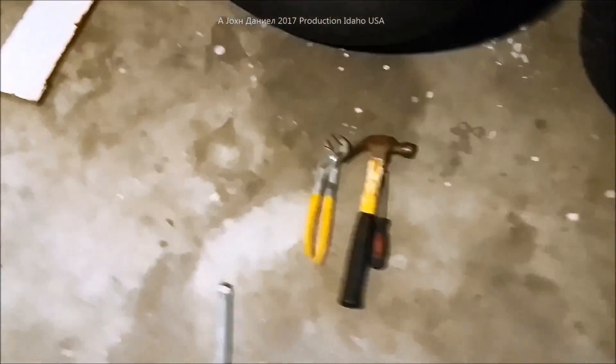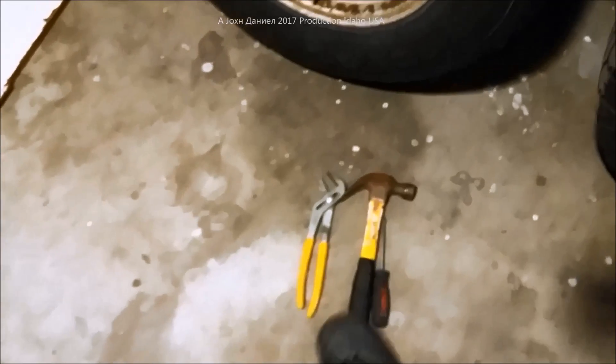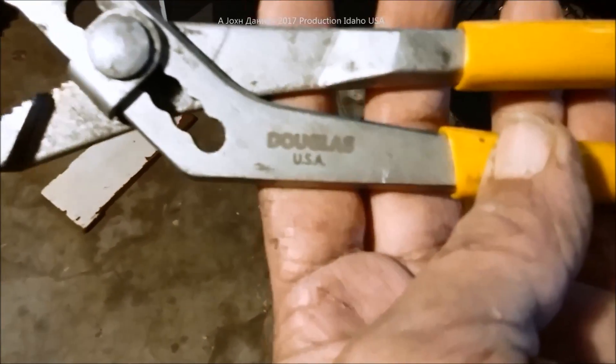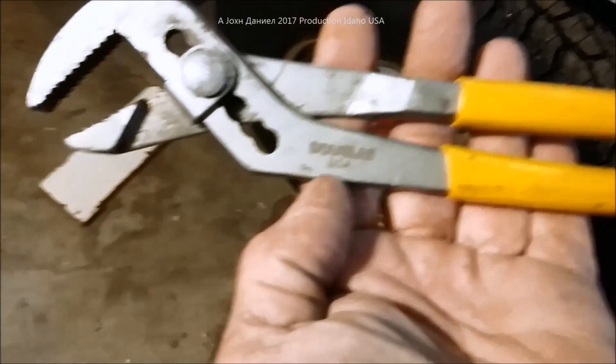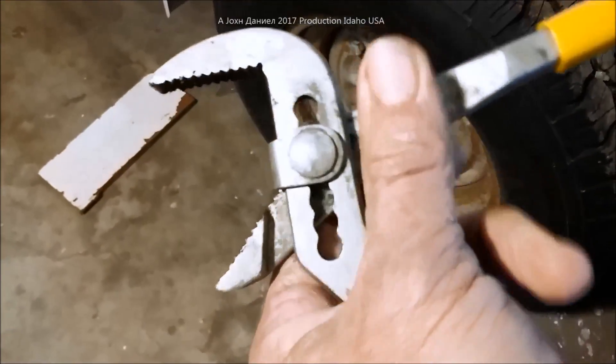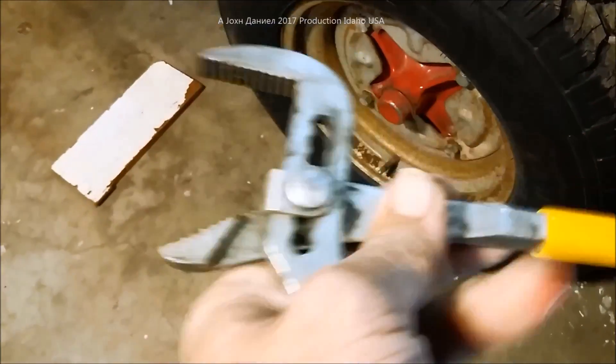So this is where we're going to start. We're going to make it real easy. We're simply going to take this cap off, pull the cotter pin, take the castle nut, and pull the whole assembly straight off. I've got the jack underneath on the axle — do one at a time, safer that way. Typical tools you'll need: a hammer, a flat screwdriver, and a pair of good pliers. I recommend Douglas — in fact, I'll put you a link. Best damn pliers you'll ever buy, hardened like hell.